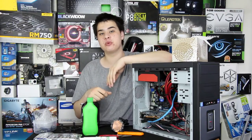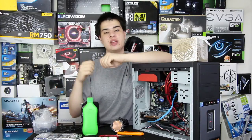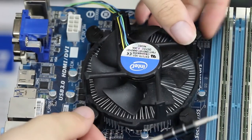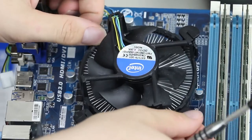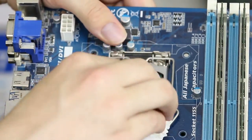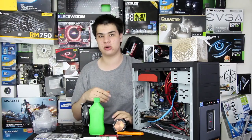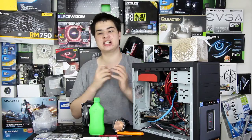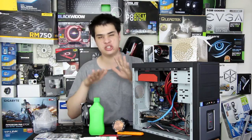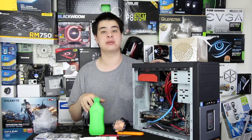With the motherboard out, remove the stock cooler by turning the little push-pins to where the arrow points into the cooler, then lift off in a cross pattern to avoid stressing the CPU. Use isopropyl alcohol and tissues to wipe off all thermal compound, getting it as clean as possible — don't pour isopropyl directly onto the CPU or near the socket, as it could cause a short. Clean up the old cooler and keep it as a backup in case the water cooler fails.